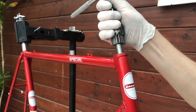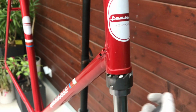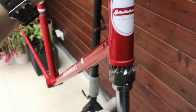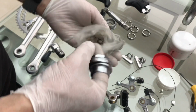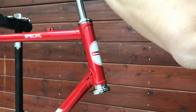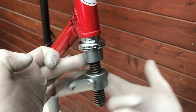Our cyclocross F1 Special has bar ends instead of down tube shifters. It is a lot better and safer because it allows you to have both hands on the handlebars at all times. In this cyclocross build, we will be doing a common practice in order to be able to shift with the rear derailleur and brake at the same time.